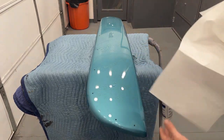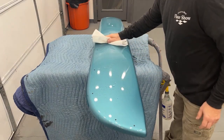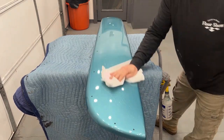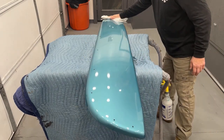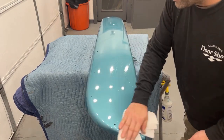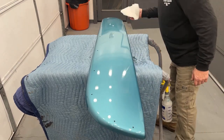Once you're done painting and it's set and dried, take either a paper towel or a water squeegee and wipe the whole panel down really good. What we're doing is making sure there's no dirt on the panel, because if you have a speck of anything on there it gets between the sandpaper and the paint and could really start scratching it — worse than what the sandpaper will do.